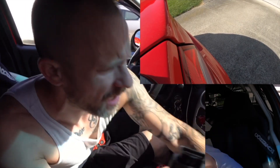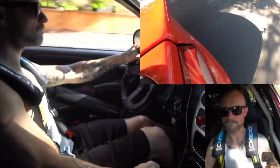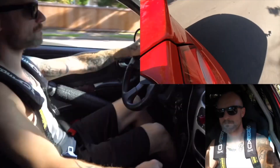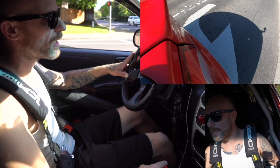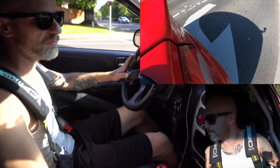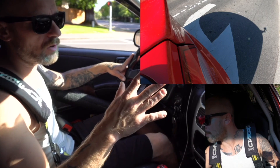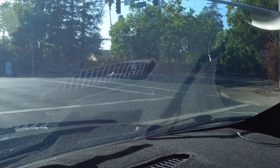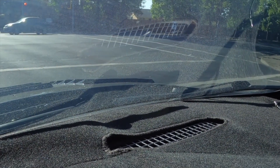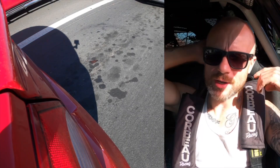We're also going to be hooking up my MPV i3. There was a crazy backfire right there. The check engine light came on earlier when I left from work, and within five minutes it went back on. I have smoke coming from my catch can — you guys can see that. I'm just going to record until I know it happened out of the catch can.